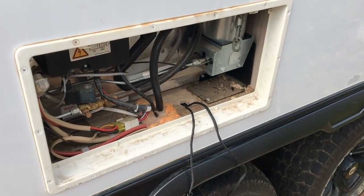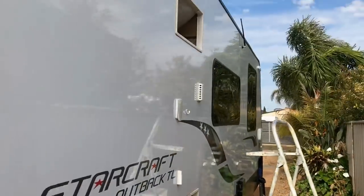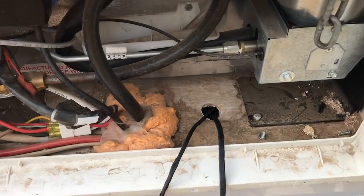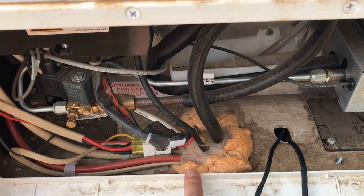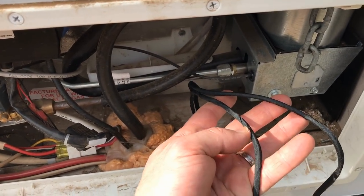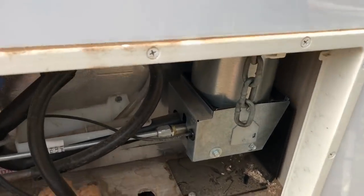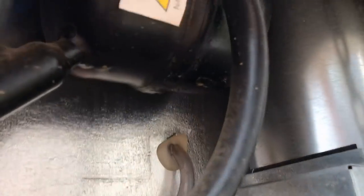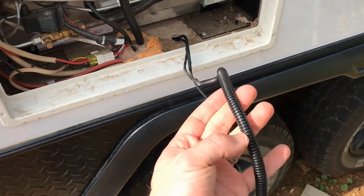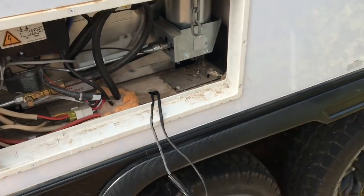Sound quality is going to be awful because it's blowing its guts out, but I've drilled — let's step back. This is outside the van, I've taken the vents out and come up through the bottom here. I drilled a hole through — I didn't want to muck around with this stuff in case there was some warranty issue with Jayco. Got the two wires going up: one's a power wire, the other's for the controller. That'll go up, and hopefully I can get behind the microwave and put it in that nice neat location. Now this is where the fridge exhausts — I do have to be worried about heat here, so I'm going to put these wires in some conduit just to protect them, and I might run it away from the exhaust.